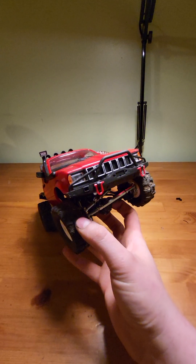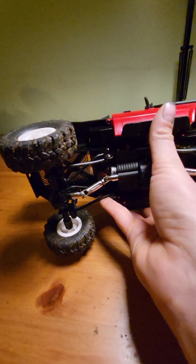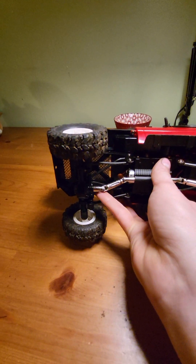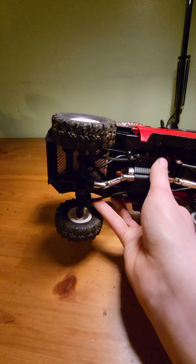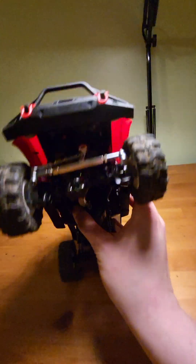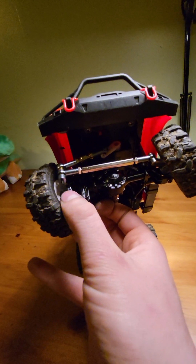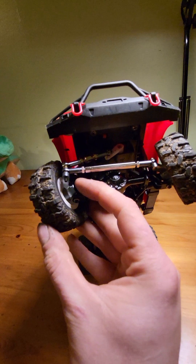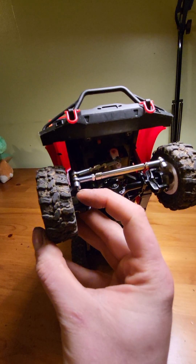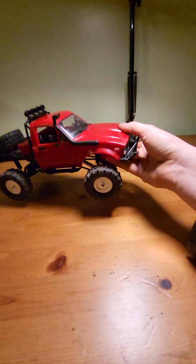The stock plastic outers have a significant amount of resistance. If you ever try rolling one, you'll realize there's a lot of rolling resistance in there. The rears are usually quite good — they don't have a ton of resistance and not as many moving parts. But specifically in the front on the RTR, this outer plastic wheel hub with the dog bone has very high friction and creates poor response from your electronics.